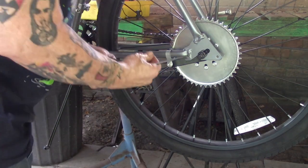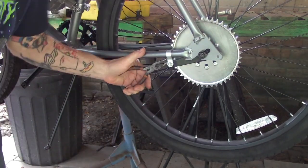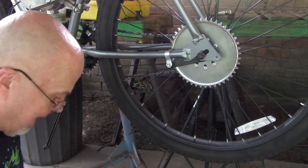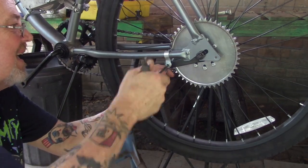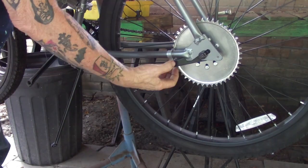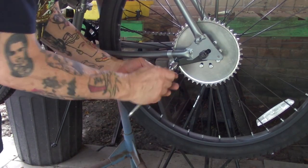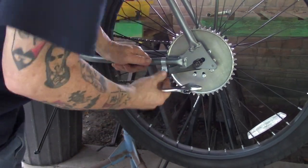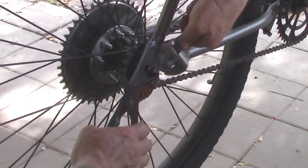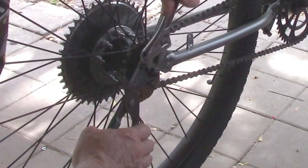Let's go ahead and tighten up the strap for the brake arm. I'll use a pair of needle-nose pliers to hold that nut behind it and then drive the screw in and get it tightened up. Check for clearance - you may find it's now too close to the sprocket and chain. What I had to do with this one was use a crescent wrench to bend that brake arm out a little more and pull it away from the sprocket to leave good clearance. Now let's turn our attention to the pedal chain - I'm using a pair of channel-lock pliers to pull the wheel back and get any slack out.